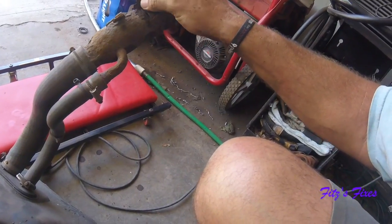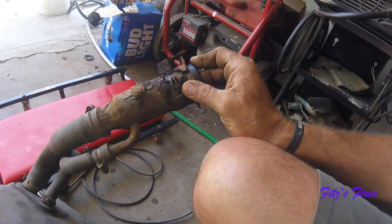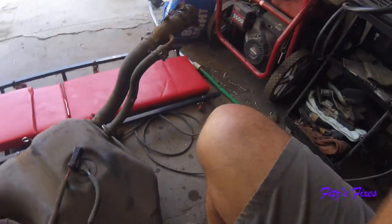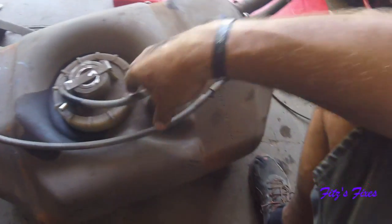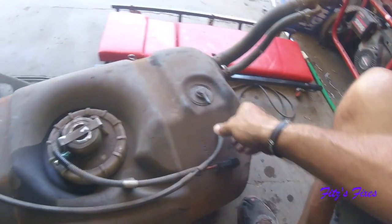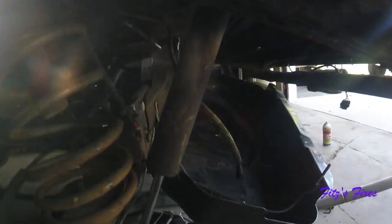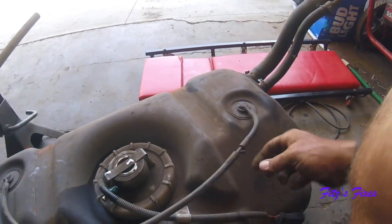This could be the cause of my vacuum leak. My check engine light for the massive vacuum leak could be right there. I've got a new filler neck on its way with the new hoses and clamps. I'm going to pop this out and take it up to the store to get another one. This can't vent to here - it fits perfectly and seems like it was that way, but that wouldn't make sense to vent one side to another. That could be a vacuum leak right there - this hooks up to this and has a small hose coming to it.